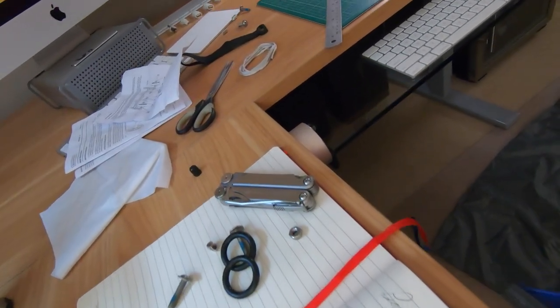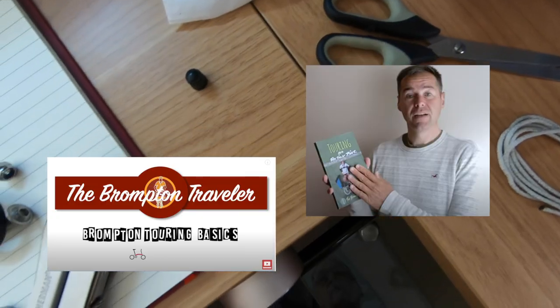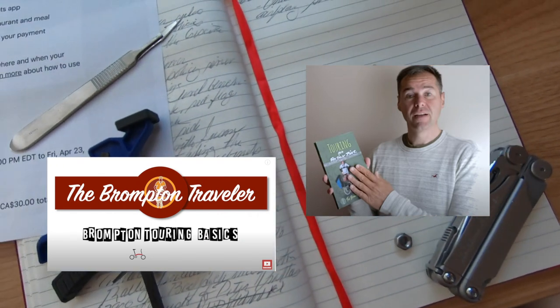What you need to know particularly for reassembly: you have to deflate and remove the tire, disconnect the hub gearing, and then once you've installed the rack and made the changes — including swapping the mudguard, since the rack mudguard and standard mudguard are slightly different designs — you reassemble. You've got to reinflate and adjust the hub gears. Both Hannah and Christine have excellent videos on this.